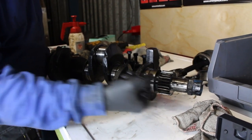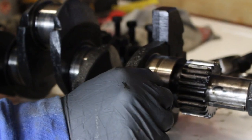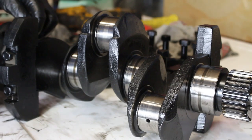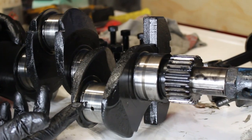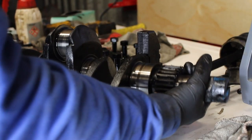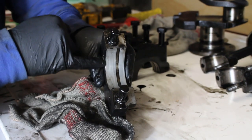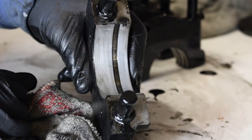They're not the heaviest crankshaft in the world — let's lay that over here. Here's the crankshaft, got that out. Here you can see the mains — there's a little mark on it, even on the conrods. That's not too bad; there are a few more marks on number three and down the far end. I'll give everything a wash so we can have a proper look at it.